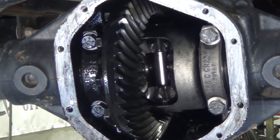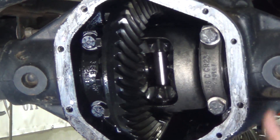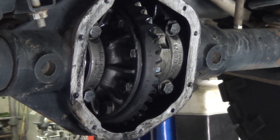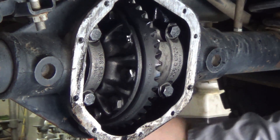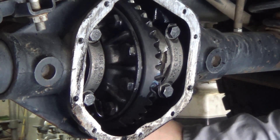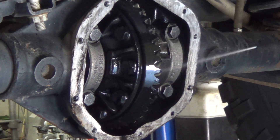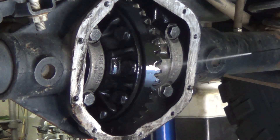When the oil gets that dark, the clutch plates in there get carbon pulled into them. When it's spinning around during regular driving, that carbon is really abrasive — just like sandpaper — grinding into those clutch plates, which are a designed wear item with a lifespan even in best case scenario. With burnt oil, it's going to drastically reduce the lifespan of those clutches. We refer to Dana Spicer's recommendations, which are well published and documented. They say the oil needs to be changed anytime the axles are submerged, and anytime the axle may have experienced a high heat environment.